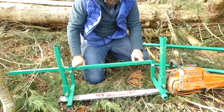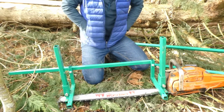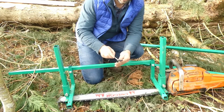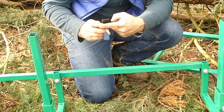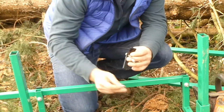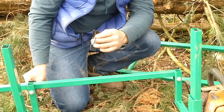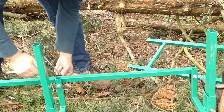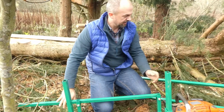The best way to put the push bar in is to put the bolt through first, and these washers, make sure you put your bolt on with your big flat washer there. It goes through the hole, and this bar is actually resting on the top of this bolt. And then you put another flat washer. Once it's through, you put another flat washer, the spring washer and your nut, so it looks like this. That's the push bar done, and now we get the H bar.